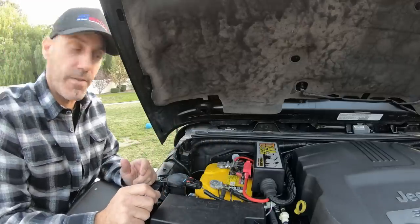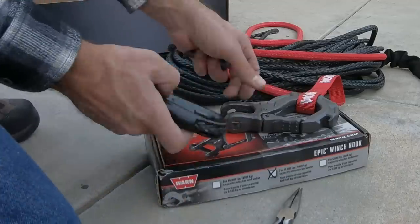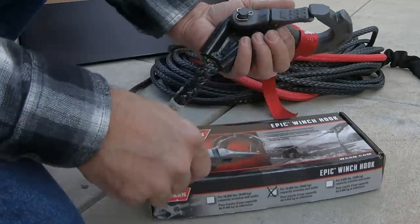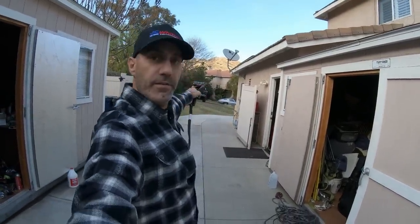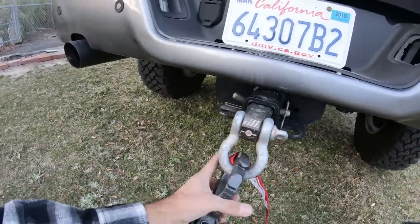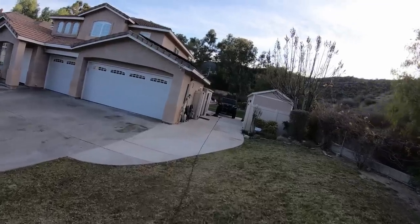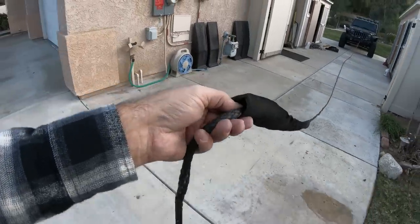Winch is back in business. Let's go wind that thing up. To put some tension on this line, we're going to go ahead and put the hook on. The hook will just go on — put your hook eyelet through, put the cotter key in. Now that you have your hook attached to your cable, we've got to find something to hook this to. There's this awesome Ram over there. Let's hook it up to that. You always want to make sure that you hook so that the open side is facing correctly. We'll use the truck as an anchor and just pull the Jeep to the truck to put tension on that first wrap.